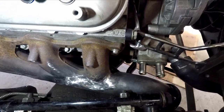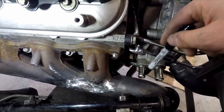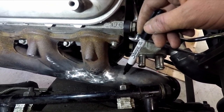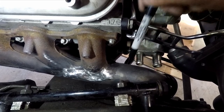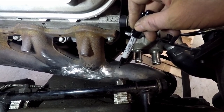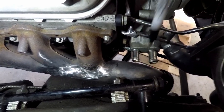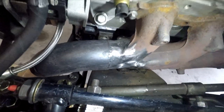We're back on the car now. I want to move this pipe so I'm not interfering with the heater hose connections. I said earlier I could tap these and block them off, but I think I can do this properly. I have to cut these back so I can go inside and dress the inside anyways. This curve here was just what I had lying around — I'll probably reuse that v-band and maybe this curve will come in handy somewhere else. I think if I cut this off somewhere up in here, I can start routing this down below the heater hoses, which might work really well.